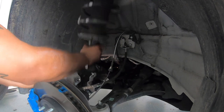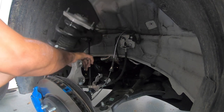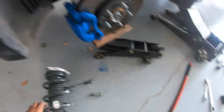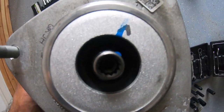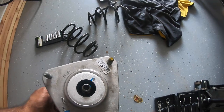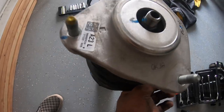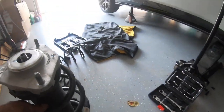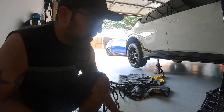The other side was easier because I was prepared. Take this out — everything is out. Now we're going to take this strut assembly and take that nut off right there. It really helps to have a good impact wrench. You have to insert a star tool and wrap it around, but that is a 19. See these arrows? These point to the inside of the car. Always remember this yellow needs to face in.